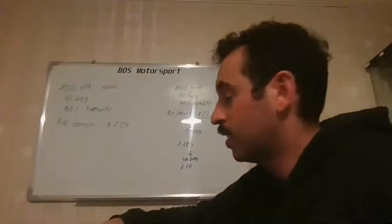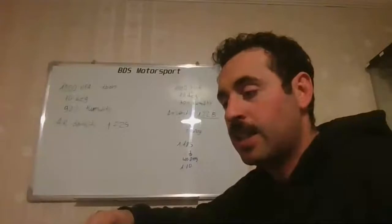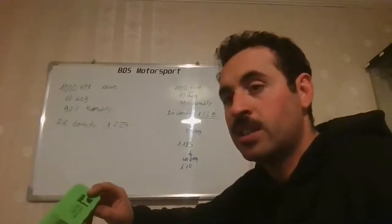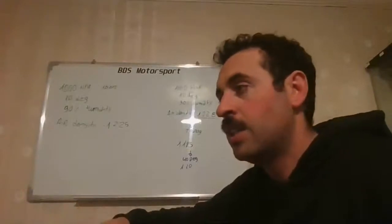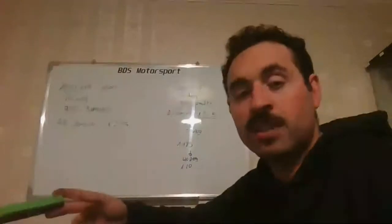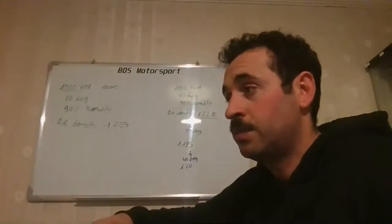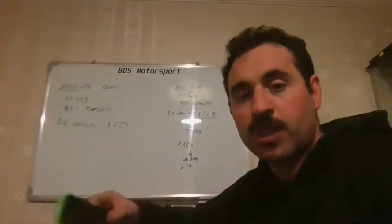So this will express it better. Other thing, I'm about to do some testing, not this week, the following week. I got my tools to start measuring atmospheric density. So when I'm on the dyno, I'm going to measure the difference between the atmospheric density and the density inside the plenums of my intake manifolds. This will show me how efficient my intake manifolds are at filling themselves up. It also gives me a good reading if I need a bigger throttle body or not. Also, it gives me the power potential the engine is going to have. So I'll have to calculate the differences.